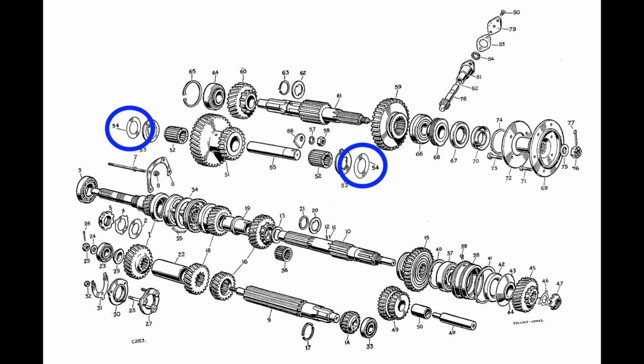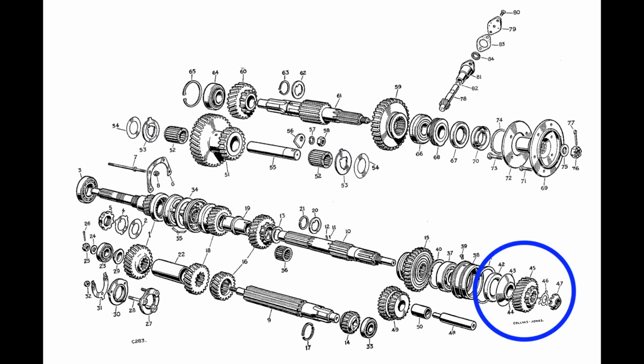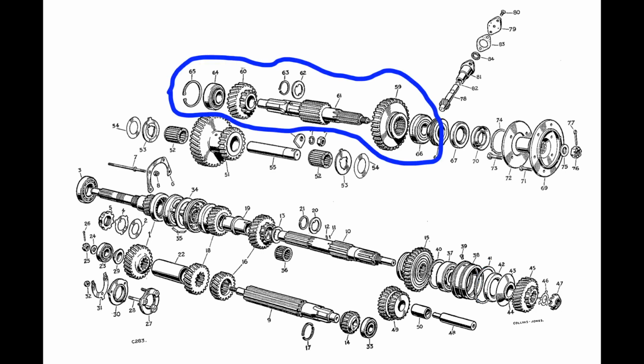The next thing, we're going to pull the gearbox out, and as you can see, the output shaft of the gearbox is being circled now. That's sitting inside, that pokes through into the transfer case, but that'll all come out as you pull it out. Just remember, as you unbolt the gearbox, there are nuts on studs on the outside, but there are also bolts on the inside of the transfer case to free that up. Now looking at the output shaft of the transfer case itself, and that's what we're going to remove in the next videos.